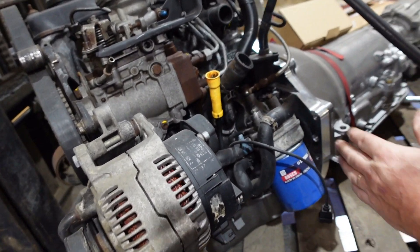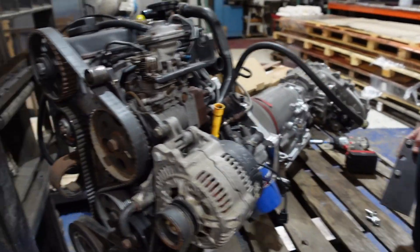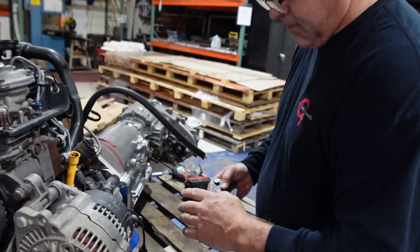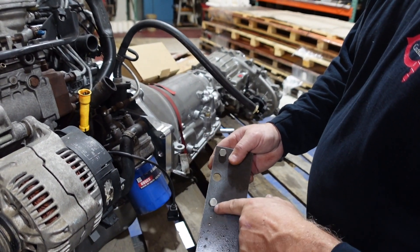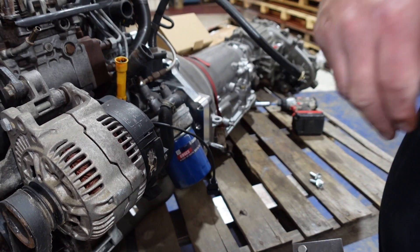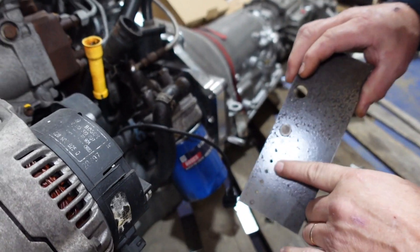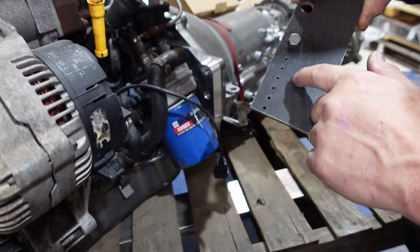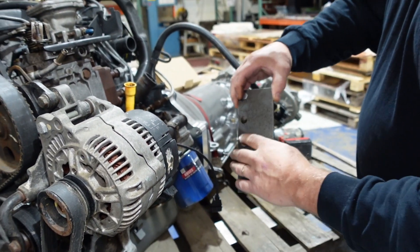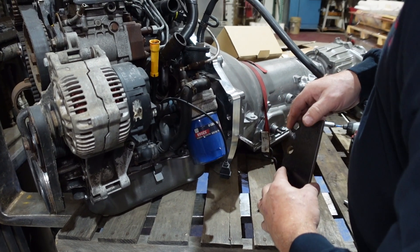You only got a couple of holes, possibly like this breather here. The way this was mounted in the Volkswagen, they had a motor mount off this corner of the motor and then another motor mount on the opposite corner. So what we did is made a mock-up plate with a series of holes. We're going to pick up the two existing bell housing bolts — those are 3/8-16 — got a locating dowel that lines up there, and we added another hole down here that we'll drill and tap. We put a series of holes spaced half-inch apart and we'll figure out which one looks the best. This is just a mock-up plate so we can get some measurements to the frame once it's in there, so we can design the actual mount.